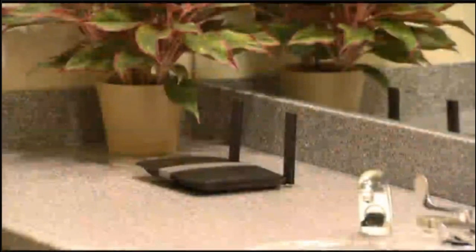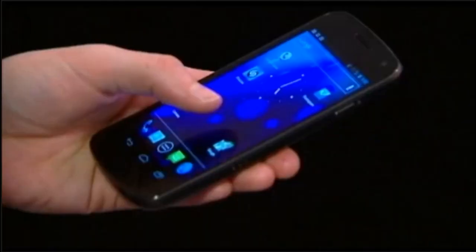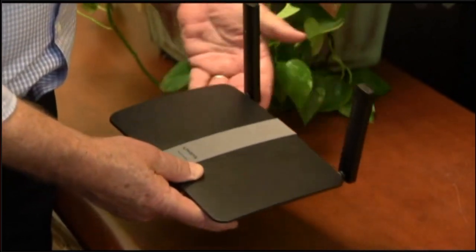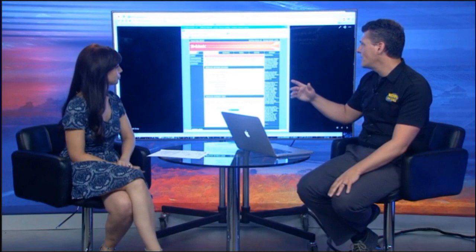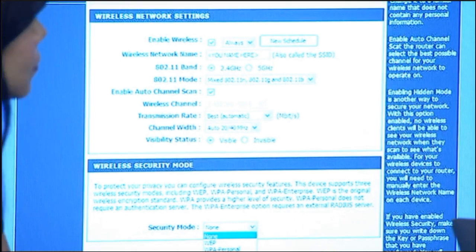You open up an internet browser like Safari or Chrome and type in the web address 192.168.0.1. It's usually right on the little box. If you have your startup disk it's even easier, but if not, just type in the web address and it'll take you to the settings page. The settings page has a login screen, and you can use the defaults, which are usually admin and admin for the username and password. If you're not sure, go to routerpasswords.com — type in your router model and it'll show you the username and password so you can log in easily. Once you're in, look for wireless settings or security settings, click that, and you can change all your settings and set up your password.